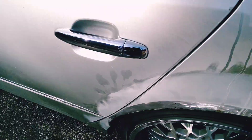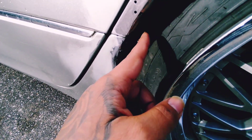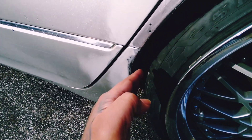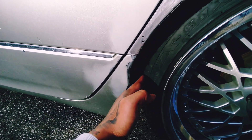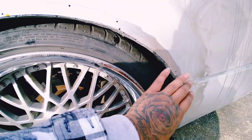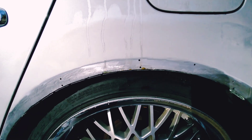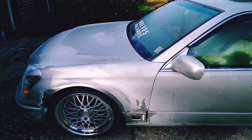The back end — initially I wanted to stop right here, but there was a huge chunk of metal sticking out. My homie said once I push the wheels out more it's gonna give me issues, and I can see where there could be clearance problems. Same thing with this side — looks rough right now but once the tapers are slapped on it covers it all completely. Weld it all up, put sealer on it, then slap the taper on and tack weld it all off.